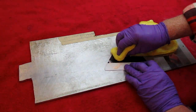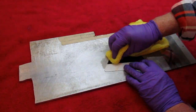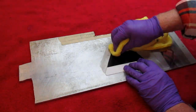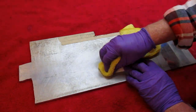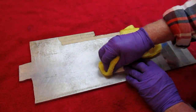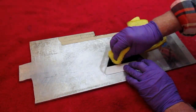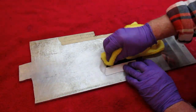And I want to just see, now this paint is not as old as... this is really for my information as well as putting on the video. This paint is really only 1 day old. Normally I would let it dry the second day. I always have felt that made it easier, and the results speak for themselves. I always like to let paint dry in between coats and outgas, which we really didn't do with this, and I don't know what the trade-offs are. But I know when you're running a body shop or a real professional thing, you want to get the parts in and get them out and everything as quick as possible.